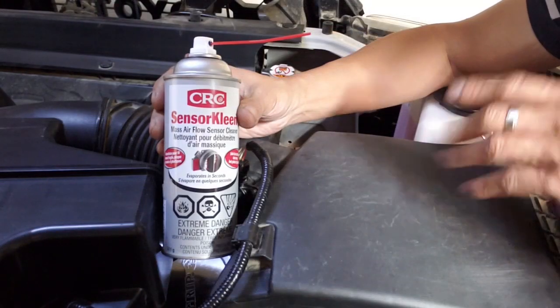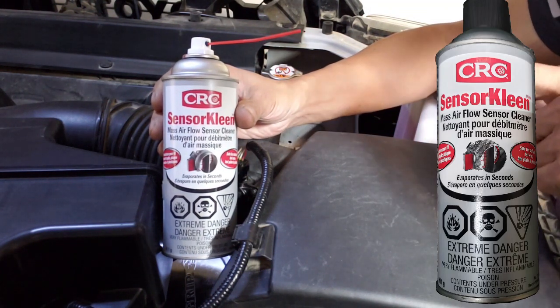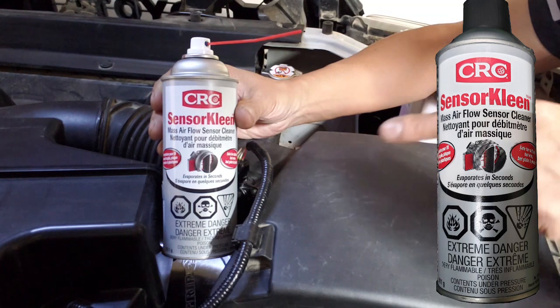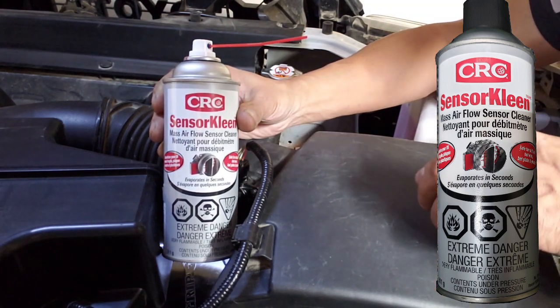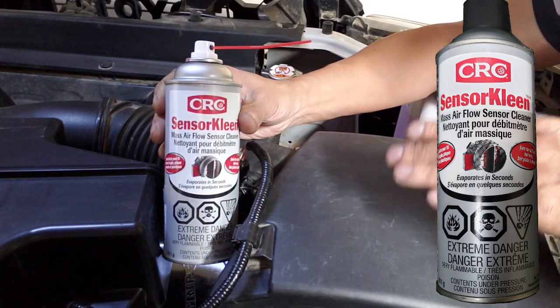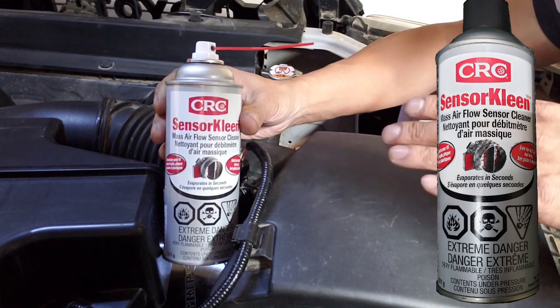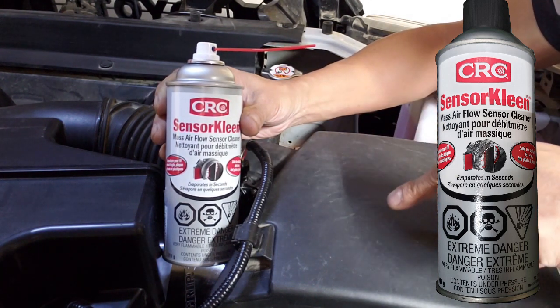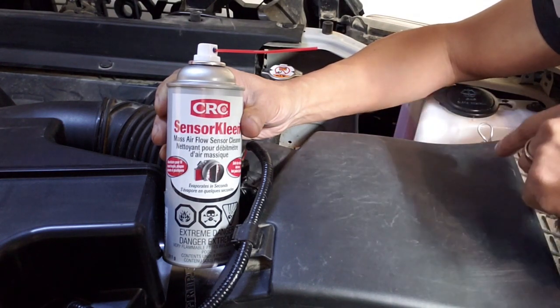One thing that I need to mention, and this is very important, use a cleaning solution that is specifically made for cleaning mass airflow sensors. Using other cleaning products may have chemical ingredients that will be harmful to that sensor, and obviously you don't want to damage that sensor. So I'll be posting a link to this product and provide you that information in the description below, so check that out.